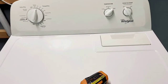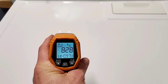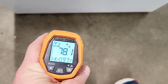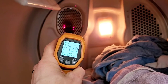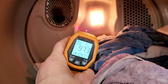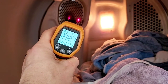I'm going to show you that it is in fact heating. Right between these two red dots I take the surface temperature measurement — it's about 82 degrees on top of the dryer; on the concrete floor it's a little cooler, about 78 degrees. Opening it up, everything is tumbling and the light comes on. Inside this tube here is the heating element tube — it's the hottest part of the dryer. The inside of the dryer heats up from about 95 up to 195 degrees depending on your heat setting.